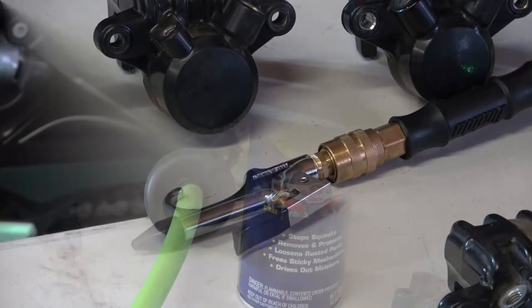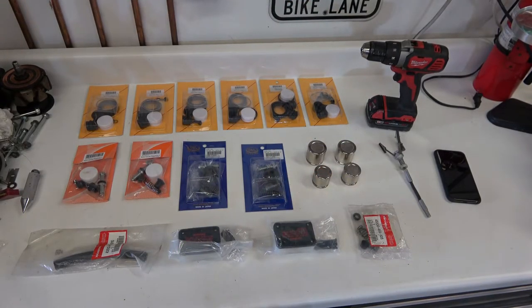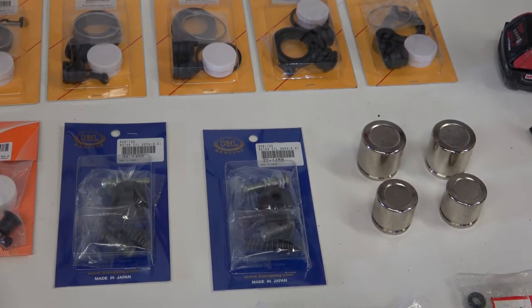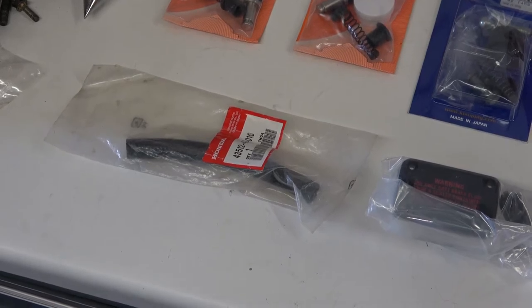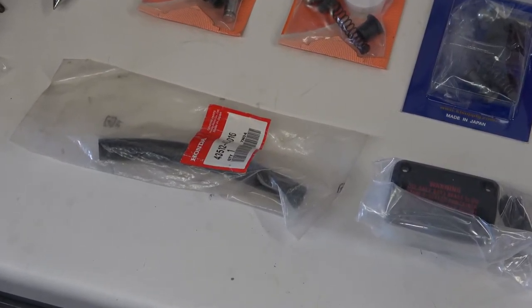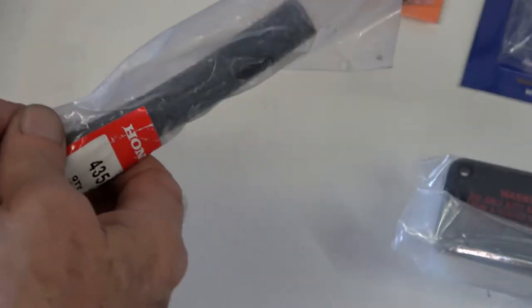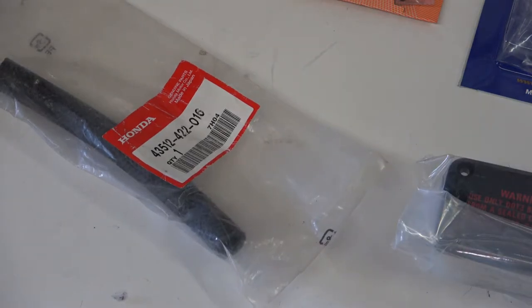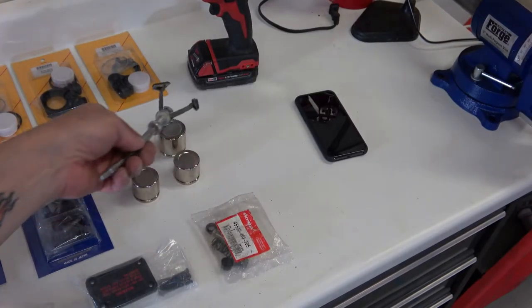It's good to have an air compressor and WD-40, because when you take these calipers apart you're going to have to use air pressure to get the pistons out. I have all the rebuild kits laid out here, including new pistons. I have rebuild kits from K&L, a couple from Honda original parts, and some from Taiwan — they're all pretty much equal as far as quality is concerned. I've also got a brand new brake hose for the rear brake reservoir. These are no longer in production, and I happen to have a couple of NOS ones. They're kind of a fabric tube and they fray over time, so it's really nice to have a new one.